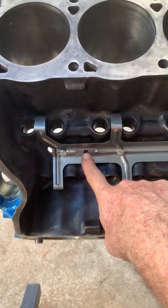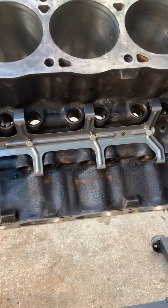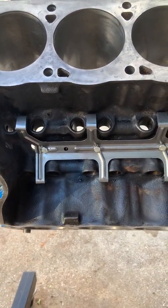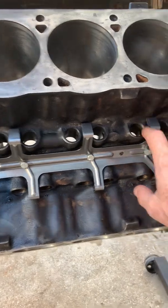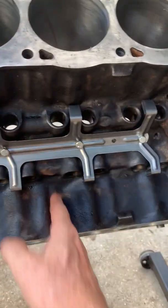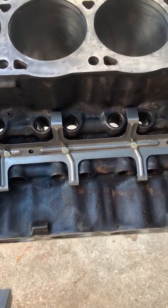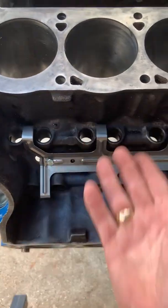To alleviate that, I used the drain holes here, here, here, and here that basically just drain back into the crankcase. I carefully picked the locations and drilled through the spider, making my own holes here, here, here, and here — nowhere near the journals. The journals are located through here, here, and on the ends. I placed my holes out by the drain holes, so if there was any issue or leak, it would just act like another drain hole.